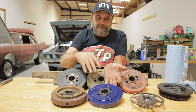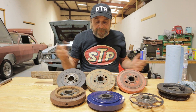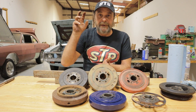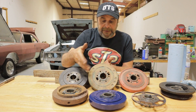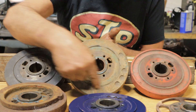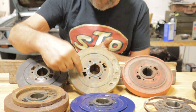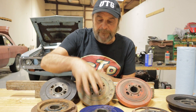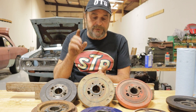Universally, they're all constructed pretty much the same way. You've got the center hub, which is just a solid piece of steel bolted to the crank — it's keyed so it won't rotate. Then you've got the outer piece called the inertia ring. The inertia ring absorbs those harmonics through the elastomer sandwiched between the hub and the inertia ring, so the hub moves and the inertia ring sucks that up.